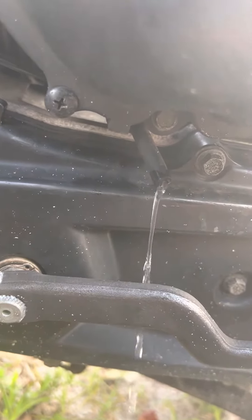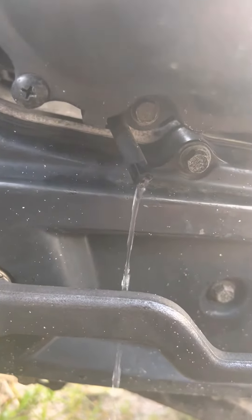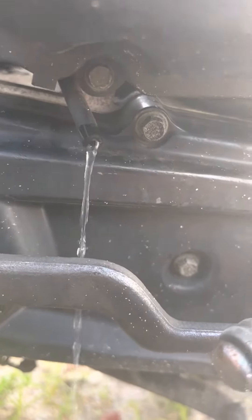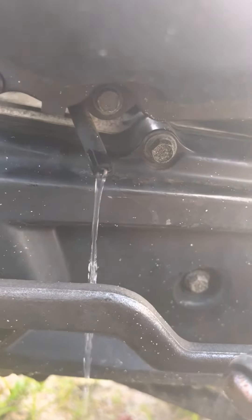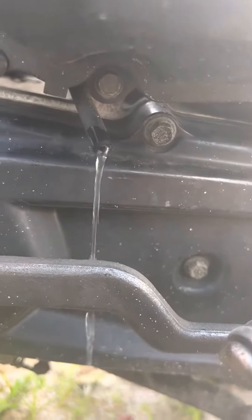There's a bowl — like a little bowl in the bottom of the carburetor. When you get flooded you've got too much gas in there, and if you haven't done this in a while you can get some buildup down there too — kind of goopy with crap. So you drain it out.